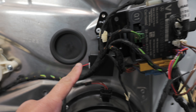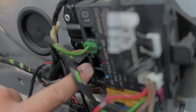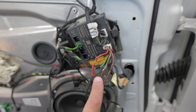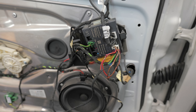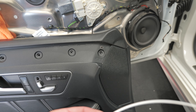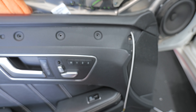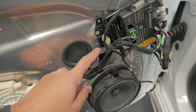The module is double-sided onto the door with the plug side exposed and ready for our lights. We've got a bunch of open plugs — we're only going to use one since we're doing one strip in this door. Get the strip mounted in the door card, run it through, plug it in, then connect red to red and black to brown, solder them up and tape it off, and that door is done. I've tapped a very small hole right here to let the wiring run through, so the strip light goes straight through there all the way to the other side. Once the door card is back on we can just route this like a normal plug straight into our module.